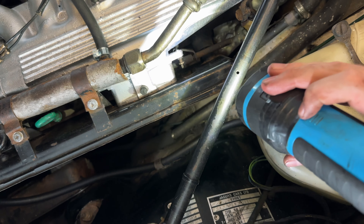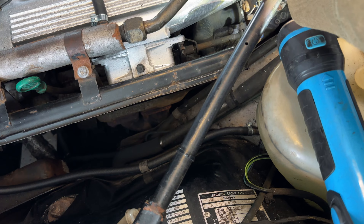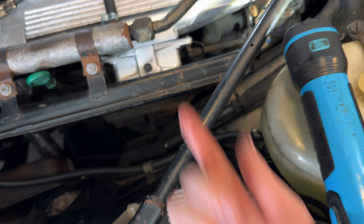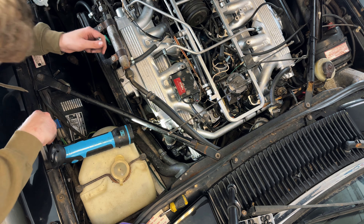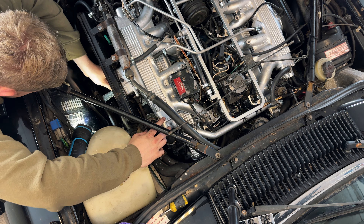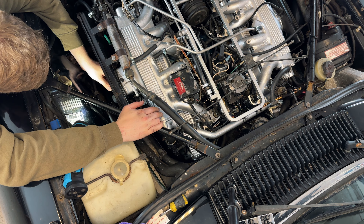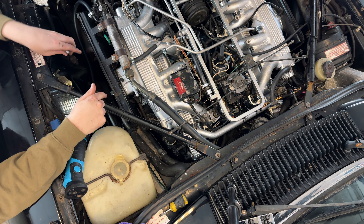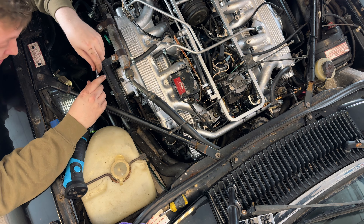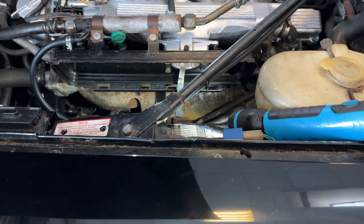If I open it and close it, it does slip straight back out — I need to adjust that. If it comes towards me it's opening, so I'll tighten it up ever so slightly going the other way — just about a quarter of a turn. That's holding it a lot more. Let's go again — that is it, the 0.002 inch. It's now sitting correctly in the throttle body.